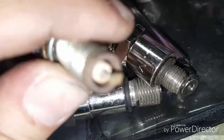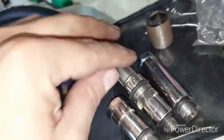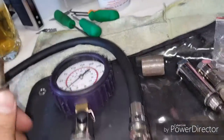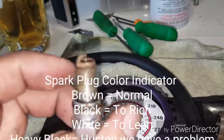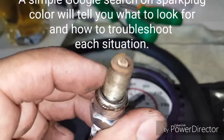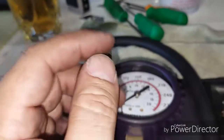If you take a look at it, this is how you'll see what size threading and adapter you need in order to get down into that well. Once you get the adapter size, you're gonna go ahead and screw it onto your hose and get that all prepped. You've got your compression gauge right here. You also want to take a look at your spark plugs and see what condition they're in — that tells you a great deal about how your bike's running, either too lean or too rich depending on the color. Mine are a little dirty and fouled, so I'll clean those up once I'm done with the compression test.